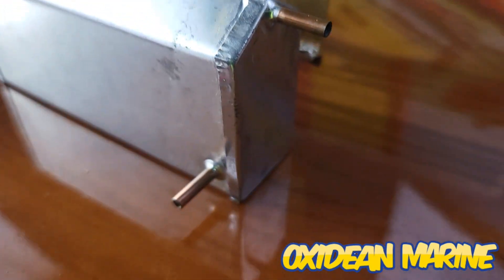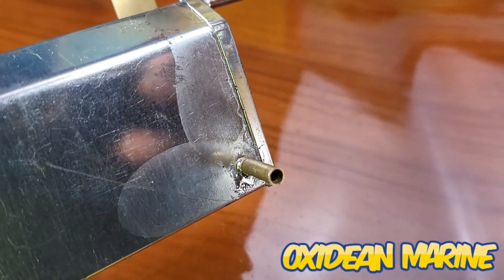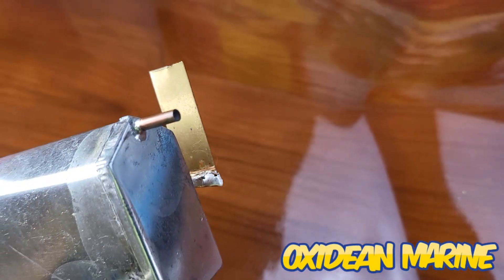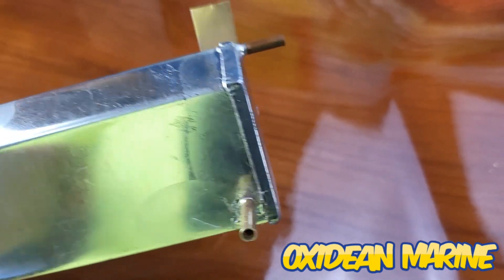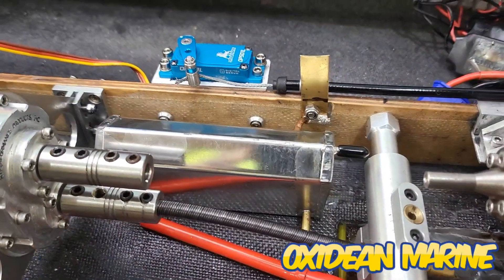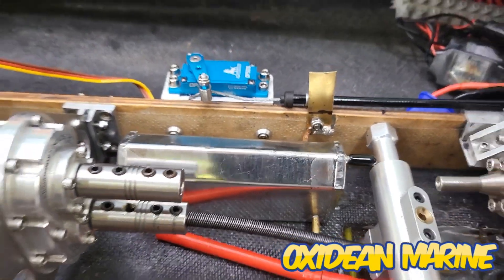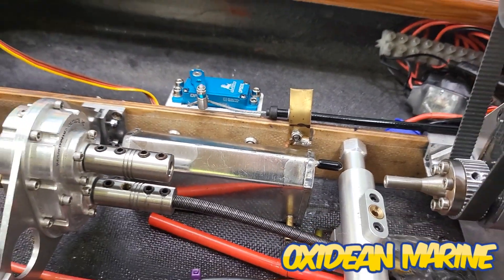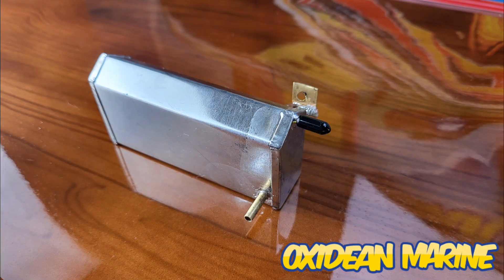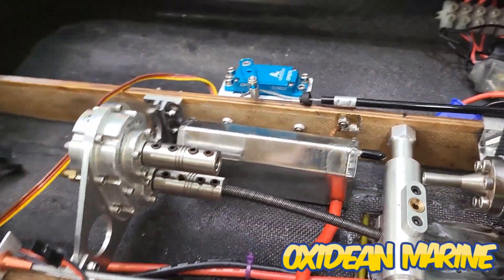I'm not super crazy about the diameter of the holes - they're really small - so I may just drill them out to a larger diameter. We went larger on the inlet side and left the vent hole the same size, because it's not putting fast liquid in there. Next we have to mock it up and drill the hole for the mounting hanger. With a little adjustment of the hanger I like the way it hangs slightly suspended. Now to cut off the excess from the bracket - we've got ourselves a puke tank.